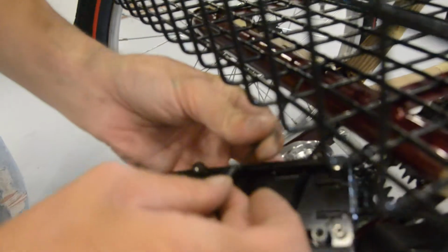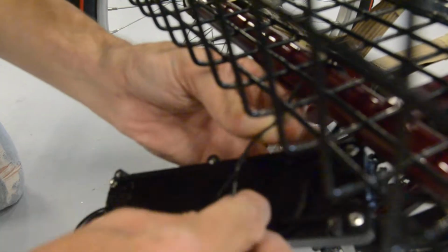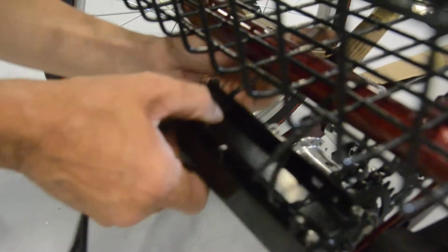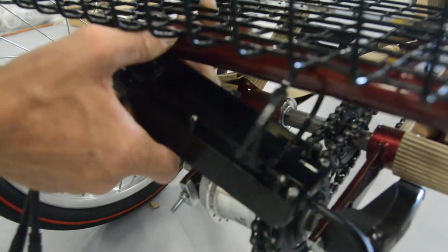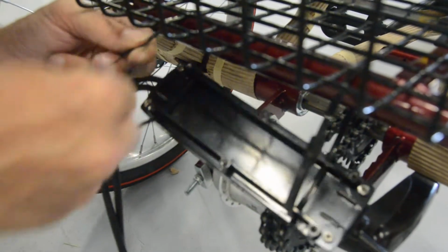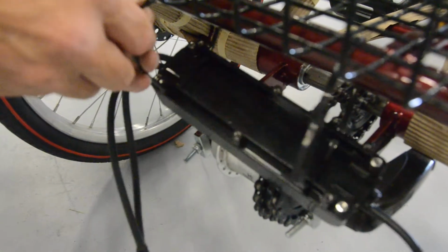You're installing these Cobra ties. The cable goes straight through the head of the Cobra tie. There's no right angles like with the zip tie. If you had an extra big frame tube back here, or for some reason you couldn't get it on, you can put this on the basket with the zip ties. It'll go just about anywhere you can wrap a zip tie around.